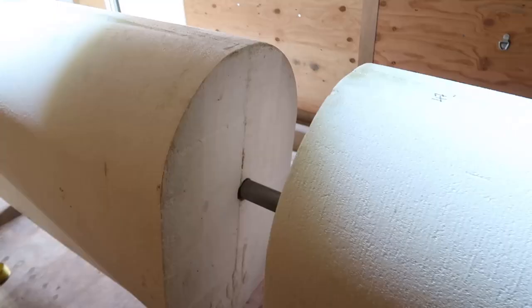I'm going to take some Total Boat Epoxy and some Cabosil. I'm going to fill in this gap and I'm going to line everything up. After that, everything should be good to go. I should be able to flip it back over and I can start fairing it in, measuring out my final dimensions to make sure that everything fits within it, and we can go from there. But yeah, let's mix up some Cabosil, some epoxy.